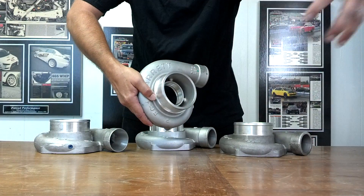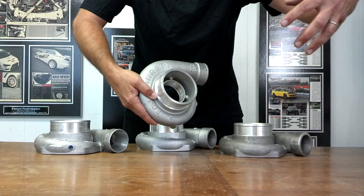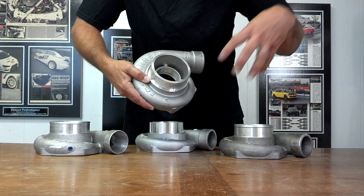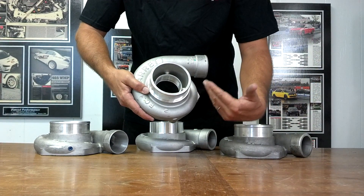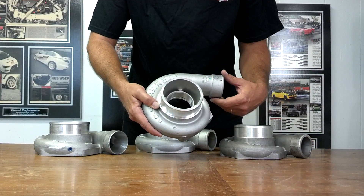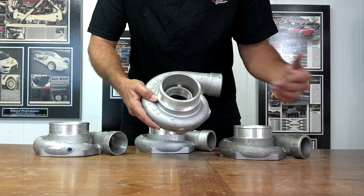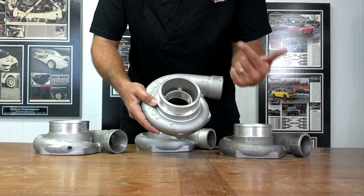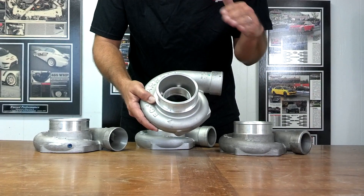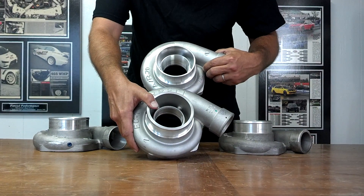You have a huge column of air sucking in towards the compressor wheel when it's under full power. This air has inertia, and at high speed it hits this area in the ring and assists the air in flowing through the splitter groove and into the surge groove — into the splitter area of the wheel, about the midpoint of the wheel in the contour. Very useful for extending the compressor map towards the right for high flow choke flow. The surge port is also very useful on the left-hand side when you're near the surge point, because it lets the compressor act like it's a smaller compressor.